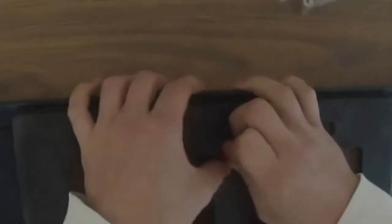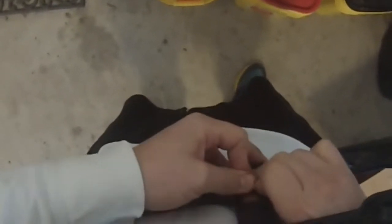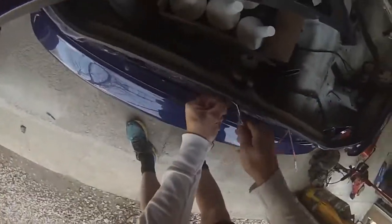The finish panel also gets these red plastic clips which go through the rear trunk wall — there are already pre-drilled holes. Install these very carefully; you'll see I'm trying not to force them. I'm using a different clip if one didn't fit, giving them a little spin while inserting. This last one gave me a little trouble so I muscled it in, but just be careful.